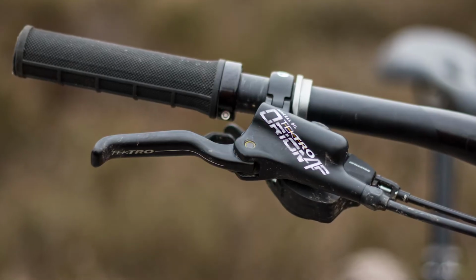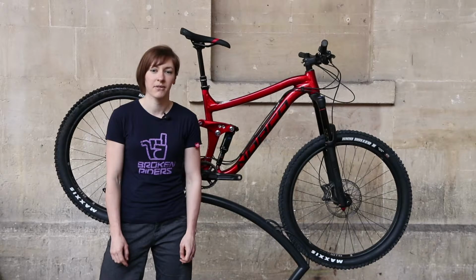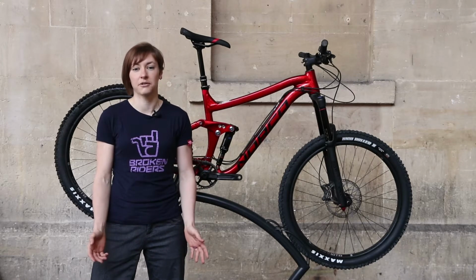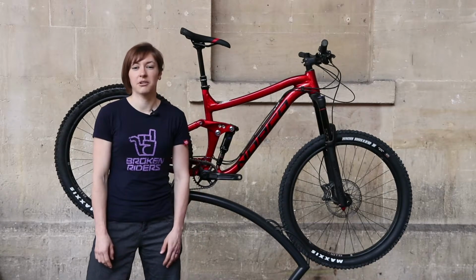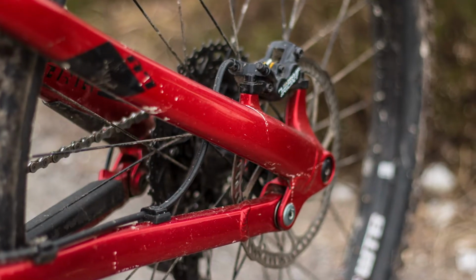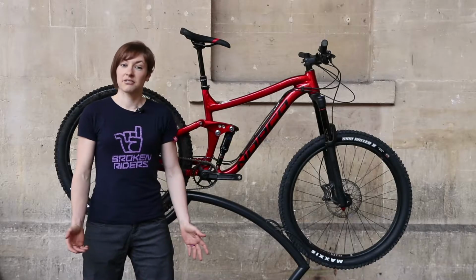Those brakes are on par with the feel of a SRAM Guide R brake, but they offer a little less power and they get hot pretty quickly too. Unlike the SRAM brakes, these are tricky to adjust the reach of, so you need a tool, and to do things properly you'll need to remove them from the bars first. I wouldn't want to use them with anything other than the large rotors provided on this bike. They heat up pretty quickly, but they have been reliable in the testing period, if lacking a little bit of feel. So how did it ride?